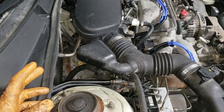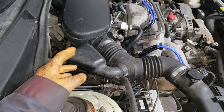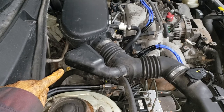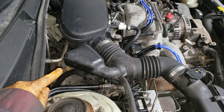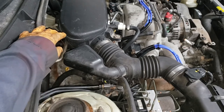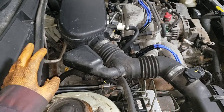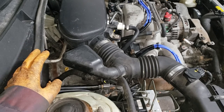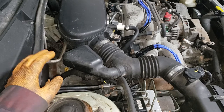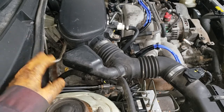Now it is extremely hard to show this process on camera for filling the front differential. Looking under the hood on the right side of the vehicle where the intake box is — that little sliver of yellow is our front differential dipstick. When you pull it out you'll need a long funnel that protrudes out far enough to fill 1.2 liters of differential fluid. The type of gear oil you need is 75W90, API GL5 specific, which is pretty much anything on shelves now — though it's not cheap at today's oil prices.